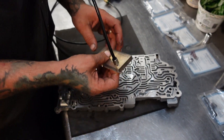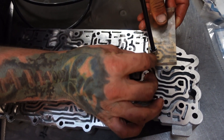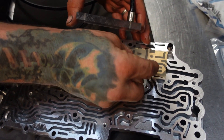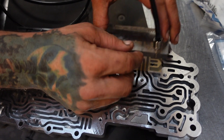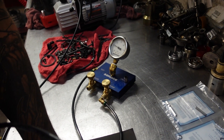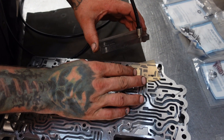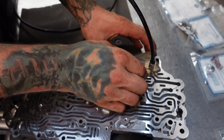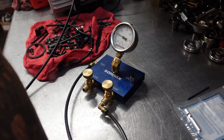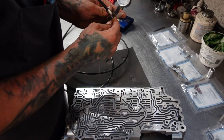Now the 1-2-3-4 clutch boost valve. This valve was kind of tricky to vacuum test because you've got that block off of that dowel pin right there. Make sure you're not stuck against that ledge, otherwise you're not good. Very good vacuum test for you. We're going to check on that side of the valve and we're going to check on the top side of the valve, because if it wears on the top side of the valve it causes a flaring problem. So we've got just a small amount of leak right there, but not enough to say we've got a big catastrophe getting ready to happen.